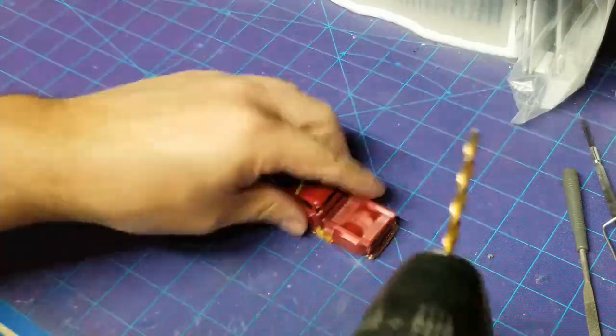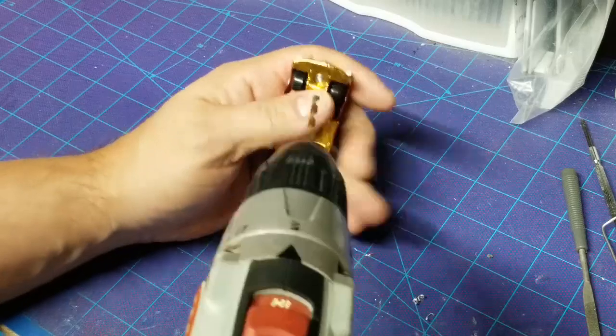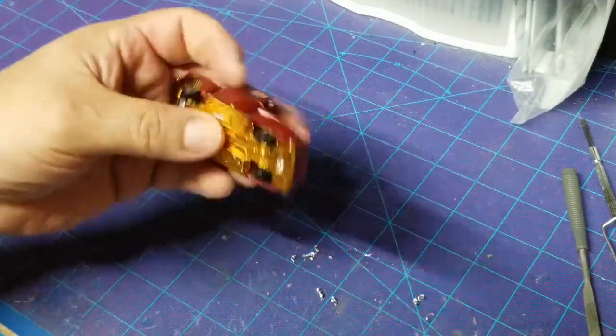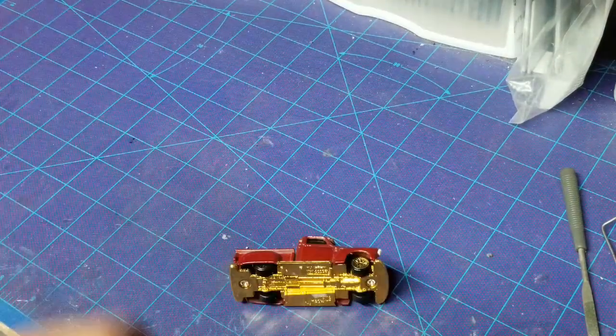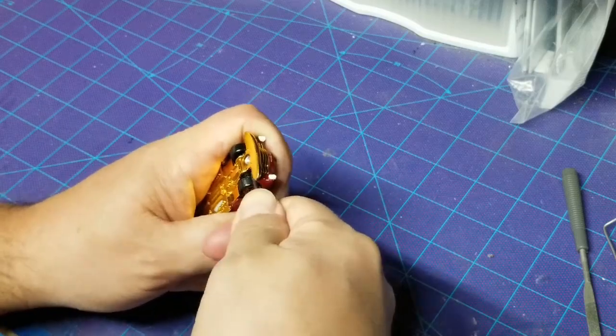As usual, we're going to use our small drill bit, get them posts drilled out, pilot holes, and we'll take our larger bit, buzz off the head of them posts there, just as they get under the chassis there, and you can bring in your screwdriver, pop the chassis off, and should be able to get at everything pretty easily then.